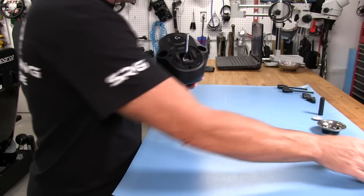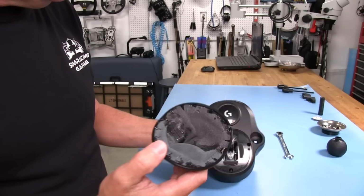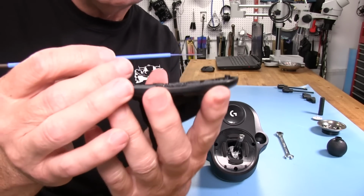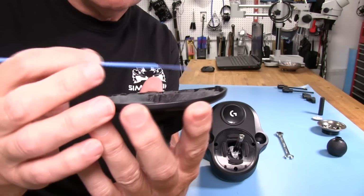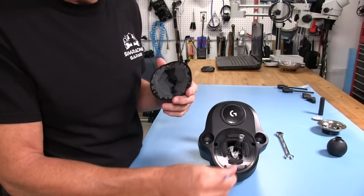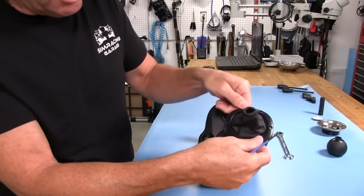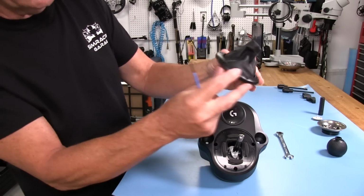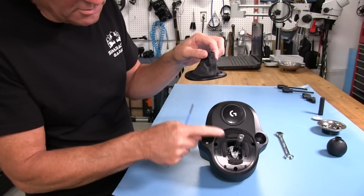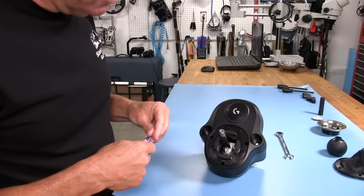And while I'm looking at this ring, I just noticed, and I meant to show you this, you see that tab in the top here? There's a tab right here. There it is, sticking up. That's the back locator tab that will go in this back hole where there's actually a screw down in there too. So that lets you not get it misoriented. It's because of the curve on it. I don't know if you guys can see that curve that well, but there's a curve there that matches the radius of the top of this housing. Anyway, you don't want to put it on backwards.